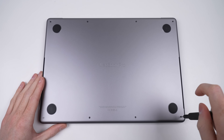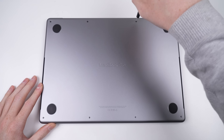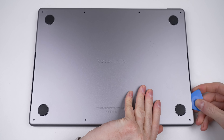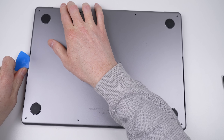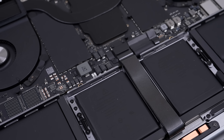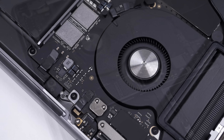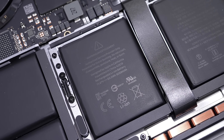Like Apple's iPhone, opening the MacBook Pro requires a specialty pentalobe driver to defeat Apple's security screws. Once all the screws are removed, there are several clips holding the base onto the top case — using a plastic pick can help free them. Inside we see the beautifully dark insides of the MacBook Pro. I'm not surprised to see the SSD NAND flash soldered in place, as Apple's been doing this for several years. The only computers they sell with removable NAND are the Mac Studio and Mac Pro. Also visible is the glued-in 70Wh battery.